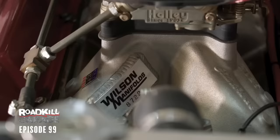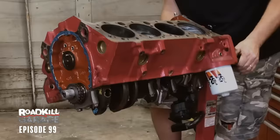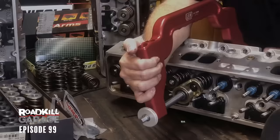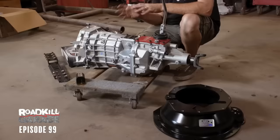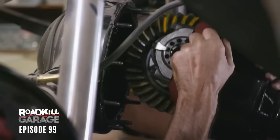Subsequently, we've hopped the thing up. Right now it's got a 500 horsepower 350 Chevy in it — I built that on an episode of Roadkill. It's the so-called COVID 350 that happened during the pandemic. It's got a T56 Magnum 6-speed in it, and it has a Ford 9-inch with 4.88 gears.